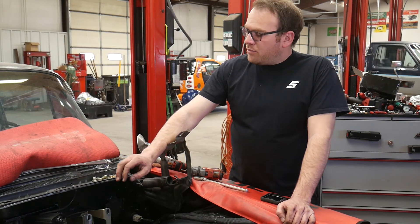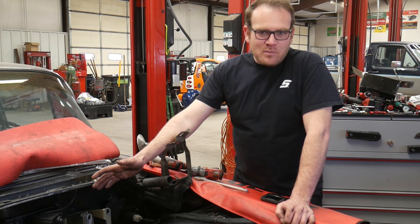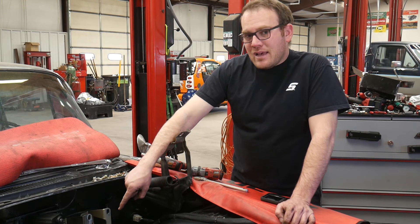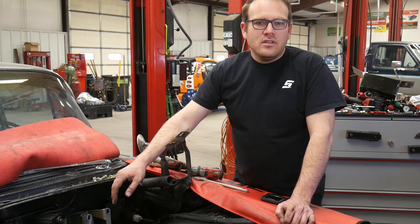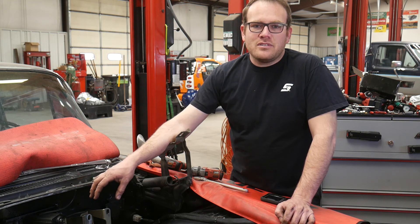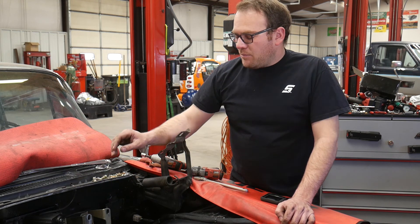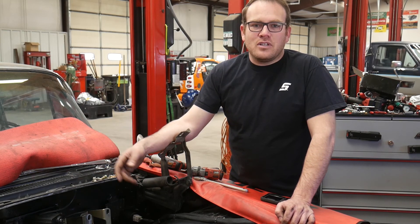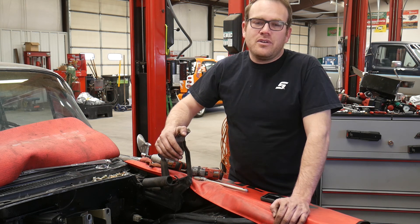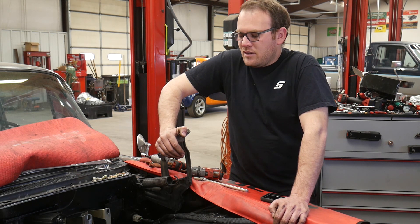That was fairly easy to install. By using the old steering column and welding that linkage, we saved a couple thousand dollars. The kit itself was only 60 to 80 bucks — not too bad, though if you're on a budget it could be a little tight. We put the bend at the top to clear the firewall and get the heim joint at a better angle, parallel with the shift linkage. The small bend down below gets a bit further from the O2 sensor and also puts that heim joint at a better angle. I think the adjustment is good — once we get out and drive it a few times I'll know for sure. If you have any questions or comments put those down below. If you want to see the rest of the build, subscribe and click the bell. Thanks for watching and I'll see you next time.